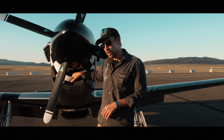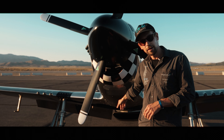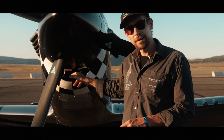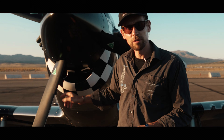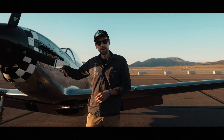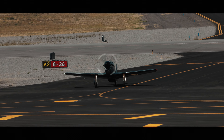What we can see here is the oil cooler — here's the inlet for the oil cooler in its original position. Down there you can find the water radiator, which we install in the famous belly scoop as it was in the original. We also see air inlets for the intercooler, which is useful to cool the air for the turbocharger, and also fresh air for the cabin as well as air for the combustion of the engine. Our four-blade MTV36 propeller from MT Propeller is composite made and constant speed, operated by hydraulics.